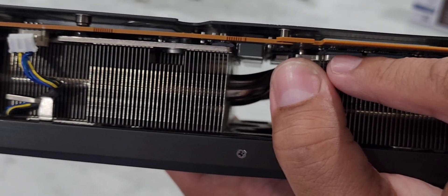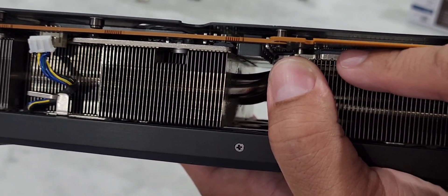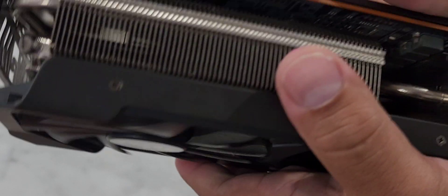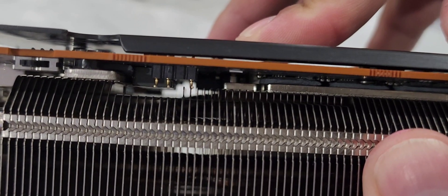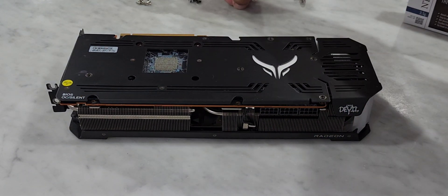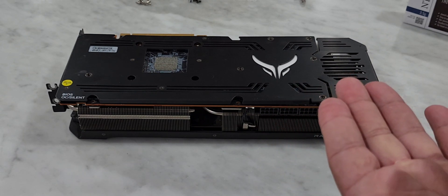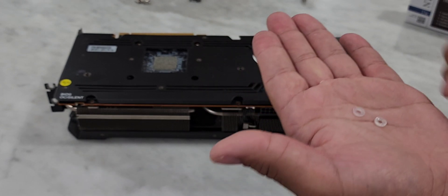Once you get the board centered with the heat sink, make sure the thermal pads are actually touching the heat sink. If they're not, push down a little harder to get more mounting pressure. Check the back part too. Right here there was a little gap — pushing down and now the gap is gone. Then apply your screws. I also did the washer mod with nylon washers, which are good for applying extra pressure to the card.